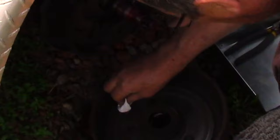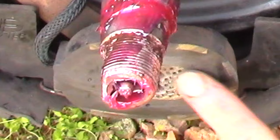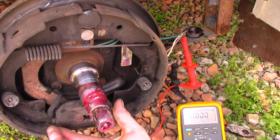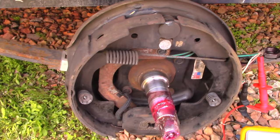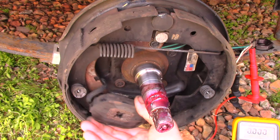Here would be what your armature is. This is your magnet. Now most electric brake magnets have some hole indicators — they're kind of like wear marks. As long as you can see them, they're wearing good. If you don't see them, then they have officially worn too much and you'd best replace that magnet. You also want to make sure that your magnet is moving freely on its post, because that's what gets sucked up to the back of the drum as it's rotating, depending on whether you're going forward or reverse. Make sure everything moves nice and freely.